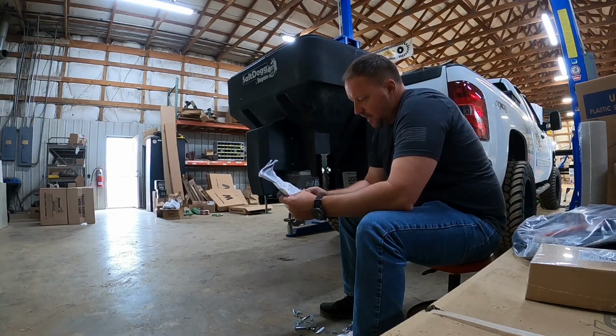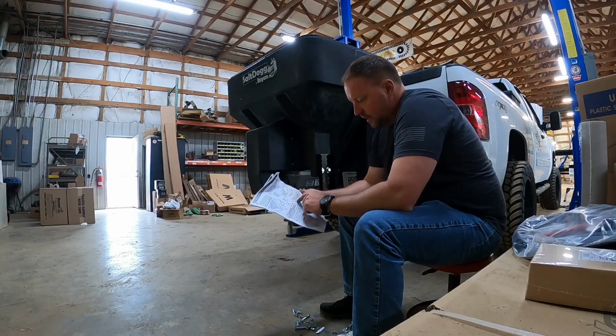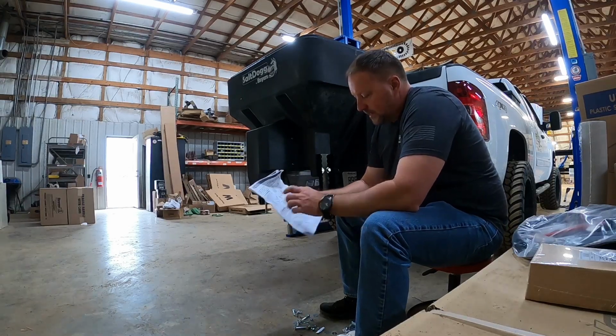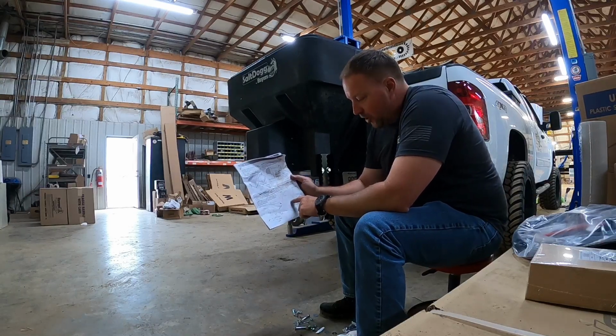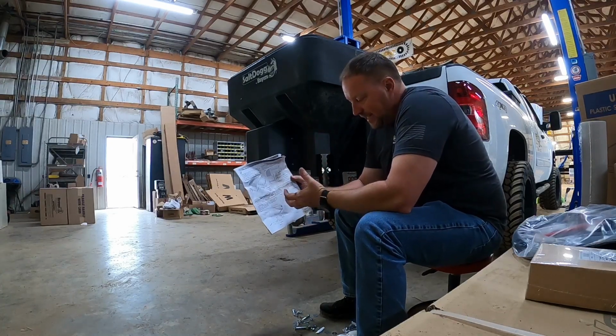It does say in step 6 to tighten the spreader to 10 to 15 foot-pounds, and then tighten the upper frame upright, finally tighten nuts located beneath the frame. They must look like shown in figure 6. After the procedure, attach it securely to the truck bumper. I read that kind of fast, it's wanting me to set it on the bumper of the truck and then tighten those 2 pieces up, and that'll pull it tight against the bumper.